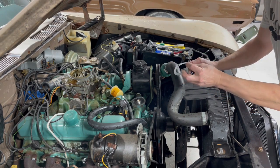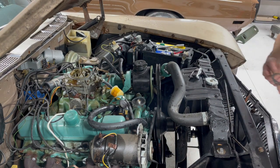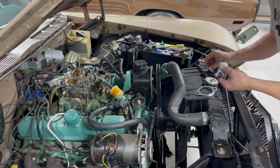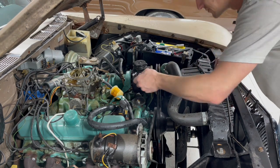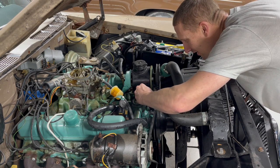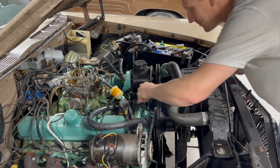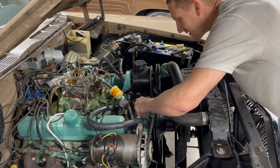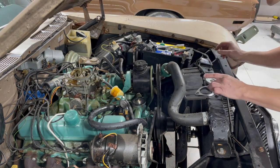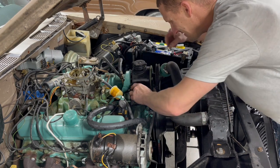And the gasket that I ended up getting had some sort of adhesive side to it, and I don't really subscribe to that, so I'm going to ignore it and just use my black RTV, a real thin bead all the way around. You can see me doing that on the actual metal surface instead of the gasket because it gets kind of a mess if you try to do the gasket itself. So throw a bead on there and smear it around with your fingers. And then set the gasket on top, like so.